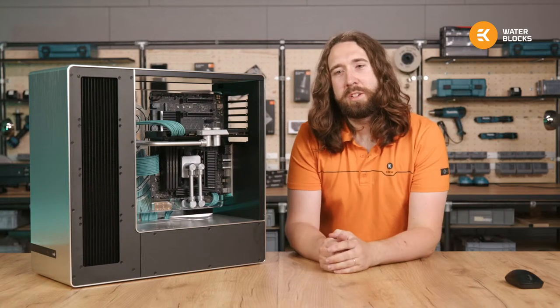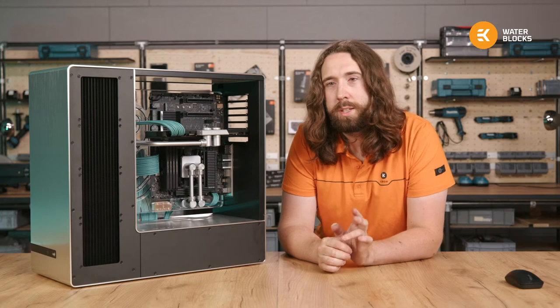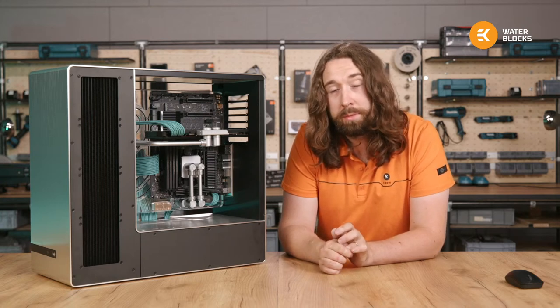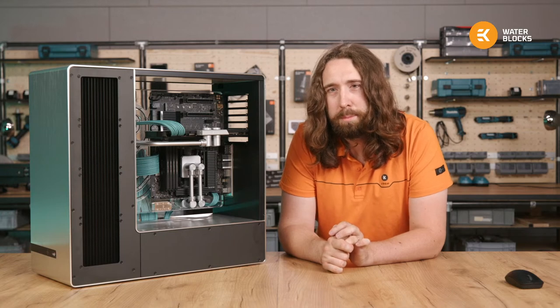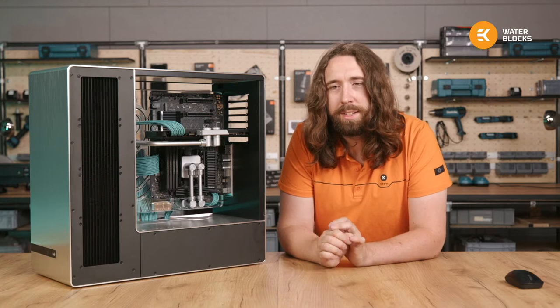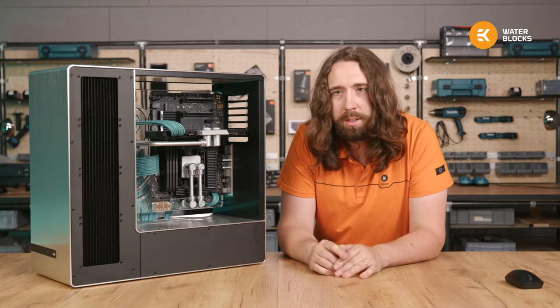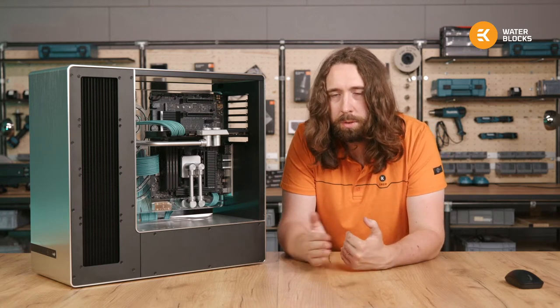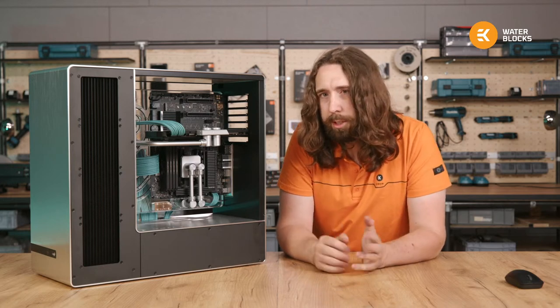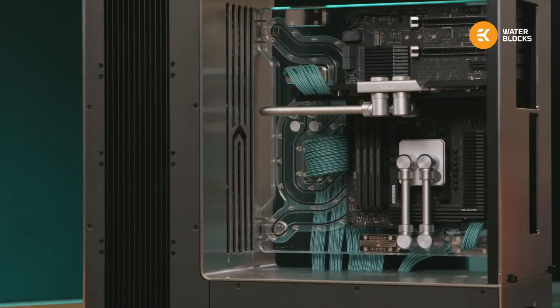The second runner in contention for me was the Asus WS C621-64L, which is a bit of a mouthful, and that's basically like a mini Dominus. So LGA 3647 socket, and it has the same hex channel layout as the Dominus, so 12 DIMMs, and it's smaller than the Dominus, so it doesn't have the huge extension at the top, and it's normally ATX size, which was the biggest thing I could fit in the 909. Would be neat, but I'm happy that I got this blacker one.